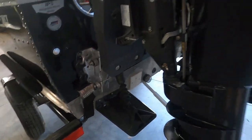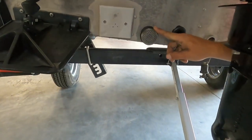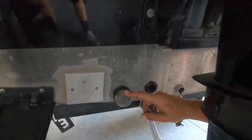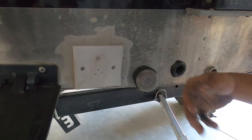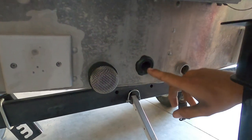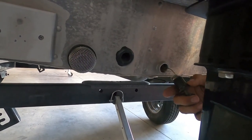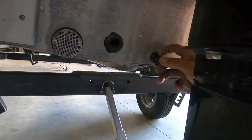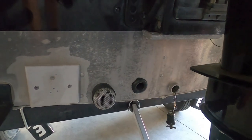On the transom, you'll see three different holes. The first one is your vent — this is the inlet for the live well. If you turn the live well switch on and it's not pumping water in, this can be clogged with debris. I've seen sometimes it have an air void in it — if that's the case, leave the live well pump on and just turn it in reverse to purge any air out. The middle hole is the drain for the live well, where water comes back out once you pull the live well plug. And this here is your transom drain plug — it's on a lanyard so it's easy to remember. You do not want to transport down the road with the drain plug in — always leave it out so we don't transport any invasive species.